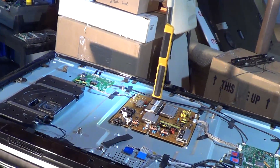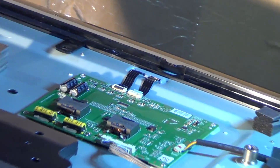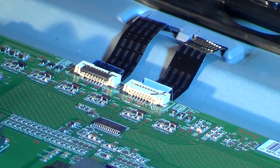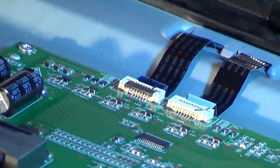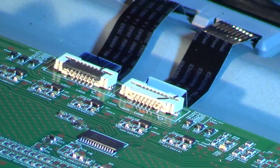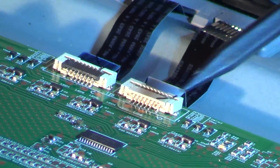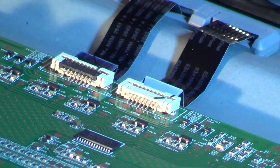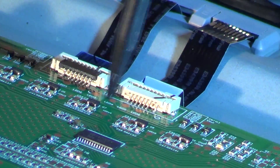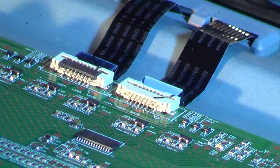I guess because the strips are longer, and they do get very hot and they shine very bright. These are the connectors on the LED driver board to go into the LEDs. So if you want to check them, you have to check them a little differently. What I used to think was that one of the plugs were negative and one of the plugs were positive. But actually it's letting you know that this plug will be for this strip, and this plug is for the other strip, like I just showed you with the two strips. And there are our little test points here, which you can actually check each strip before you even open the TV up.